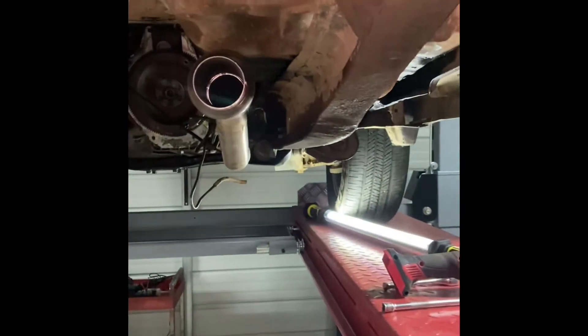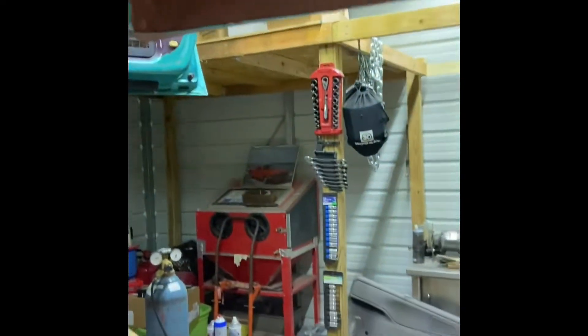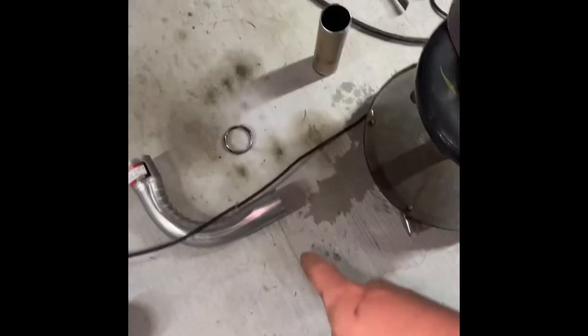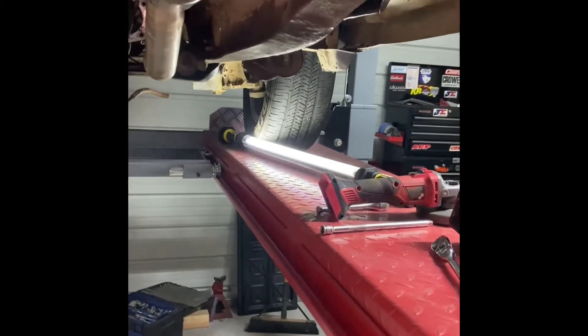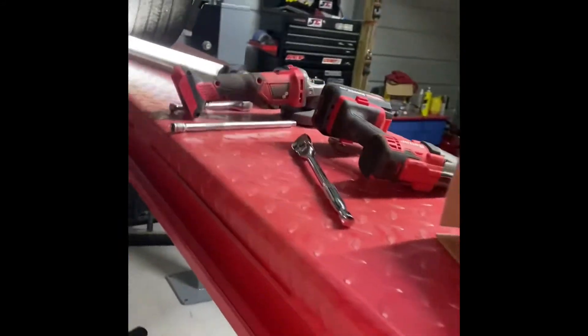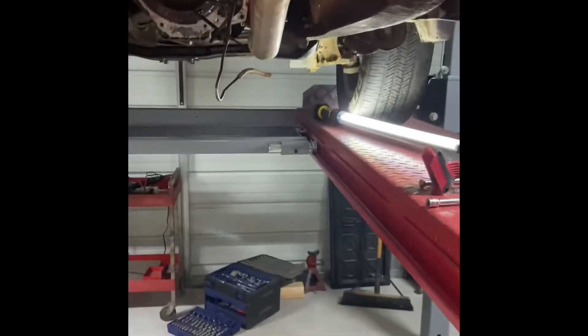New day. As we left off last night, I tacked all these together and tacked this pipe in. I've now tacked this muffler in and bolted it up. As you can see, we're heading right back where it needs to be — as it was factory, it's going to come straight up through here and hit that old bracket. At this point I need to come on straight and then turn and come out to the side here. I'll see where I can get it to — I may come straight out into the other muffler, because it's going to be right behind the cab, which might be pretty cool.